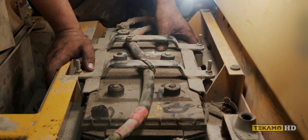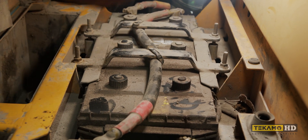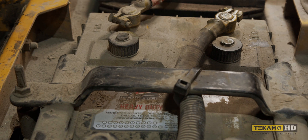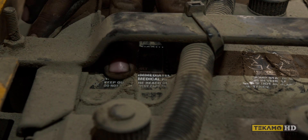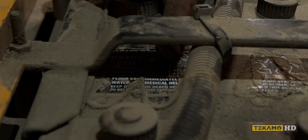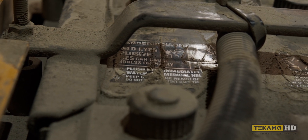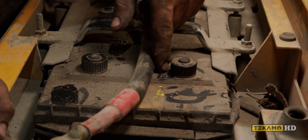They've got a little bulge to them — not terrible. They are plastic, but there's gas inside here — pressure builds up in your batteries when they start working. It's a chemical reaction: lead and acid, so you do get gas in here, hence the explosions and all that. But they will bulge. This one's a little bulgy here. You can kind of see the battery's got a little bit of a wave on the top of it. This one is actually not as bad, and honestly probably because it's been ventilated — you can see it right here.